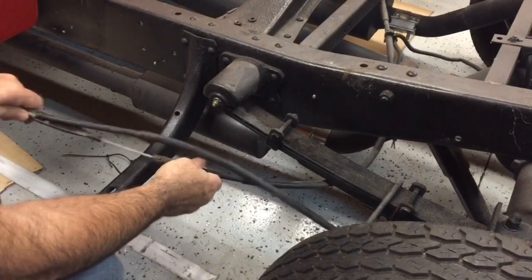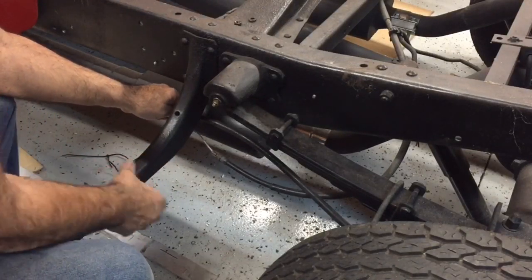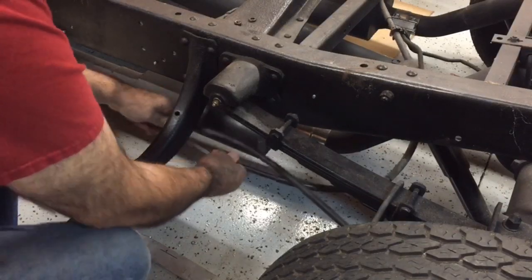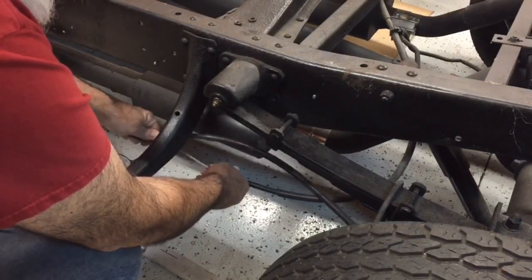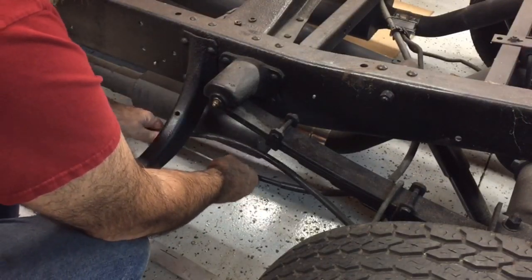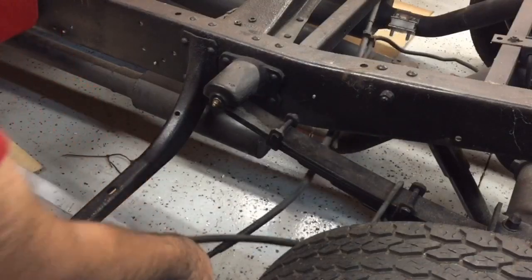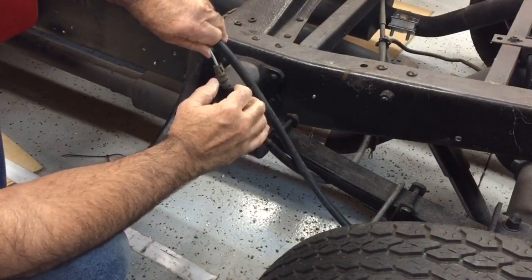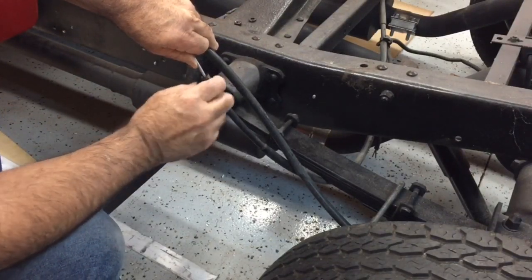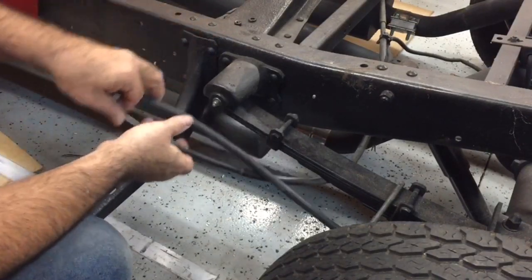So what I'm going to do is make an anchor point. I'm going to mount it to the bottom of the running board support — I'm going to put a bracket here. You have to leave enough slack in the driver's cable so that when it pulls, it has enough room to pull that sheathing, so it's going to come back probably about four inches back here. And I have to make a snap-in for the cable sheathing — it's got little prongs that pop out. It's about 17/32nds diameter hole through, and then you need a slot for the cable to fit over it.